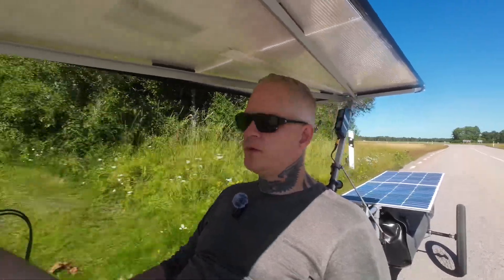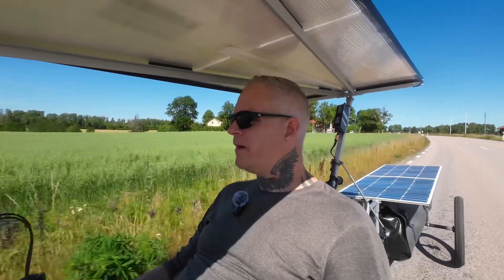If you're going to make solar viable — actually useful — you cannot treat your e-bike like a moped, because the amount of solar I have was planned with pedaling in mind. The motor is strictly there to assist me; usually I use about 100 to 200 watts for cruising on flat roads. If there's a big hill, I push the button and I have 600 watts, though I can tell you it's not that powerful with all this weight. Today I'm fully loaded — the trailer is packed with all the gear for my tours.